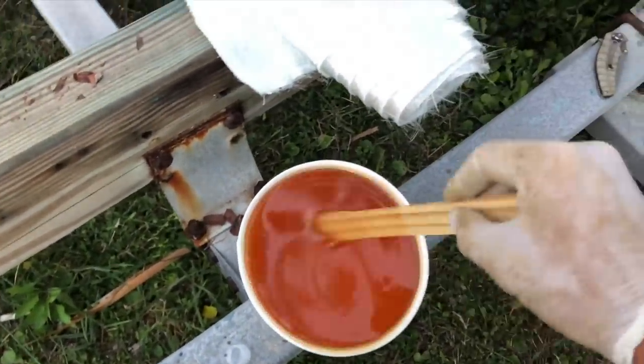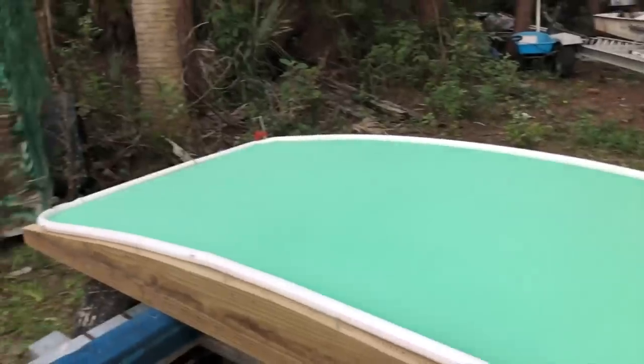We're mixing up some slow-cure epoxy laminating resin and we've got the frame all laid out. We took a one-inch PVC pipe and wrapped it around the edge of the foam. We used the radius of the bottom of a five-gallon pail to draw out the curve on the corners, then heated up the PVC slowly and bent it around the pail to get that same radius. I used a little wooden dowel that fits snugly into the PVC to join the pieces at the joints. The PVC frame gives a nice radius around the edge, a lip on top for rainwater collection, and a handhold around the edge of the bimini. Now I'm going to laminate the 1708 glass onto it.